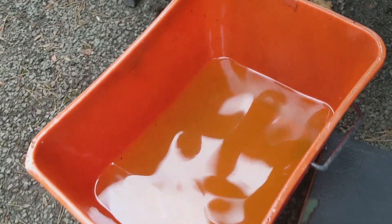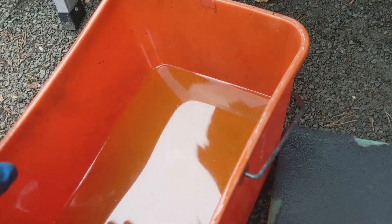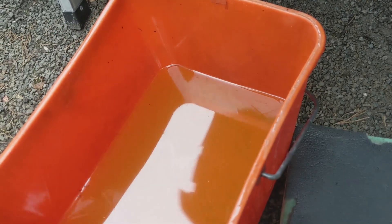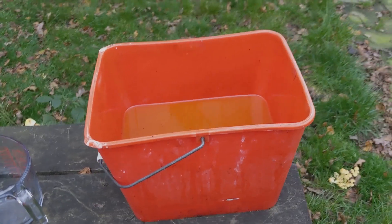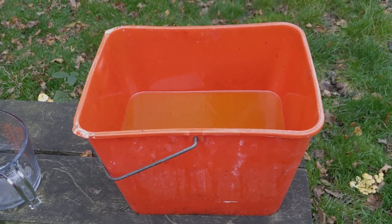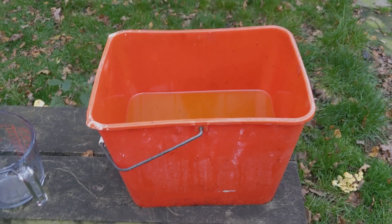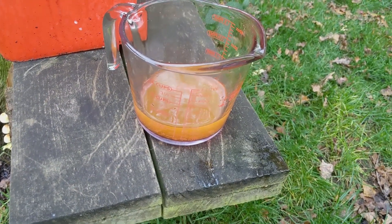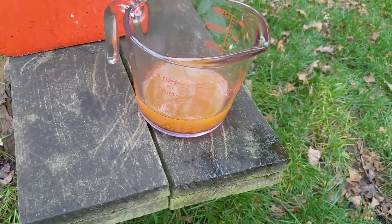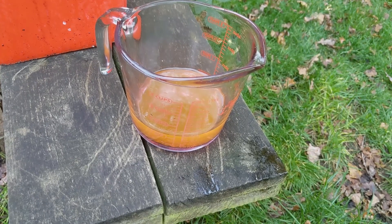My curiosity is how much fluid we've actually drained. I captured about 97–98% of it — very little went on the floor. I'm going to measure the amount of coolant drained, since when you're estimating how much coolant to buy it's useful to know. The total system capacity is around 14 litres, but we actually captured 6.3 litres, so roughly seven litres to account for what was lost — that's about half the total coolant capacity.